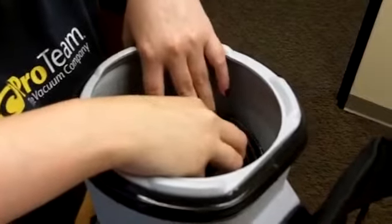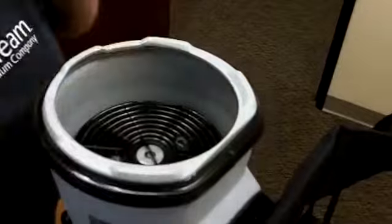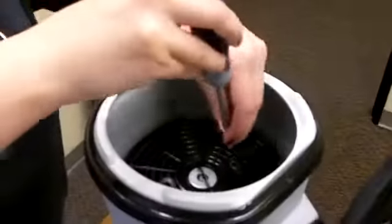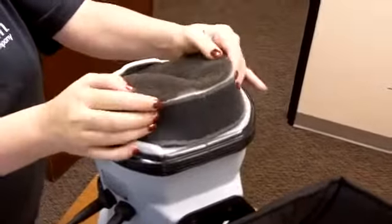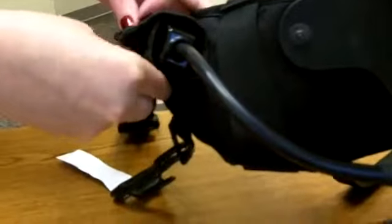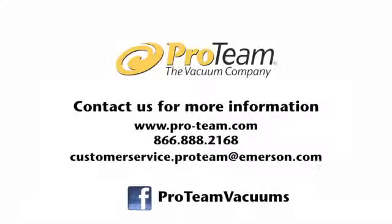Align the top piece of the motor shroud with the holes over the motor and push until you hear a click, then attach it with two bolts. Install the foam diffuser. Insert the switch box into the Velcro waist belt pocket.